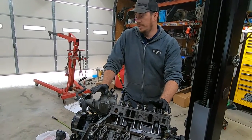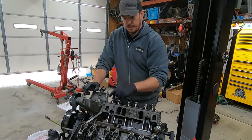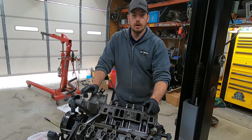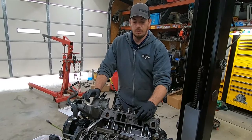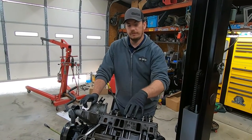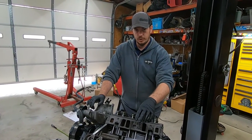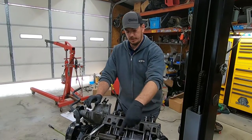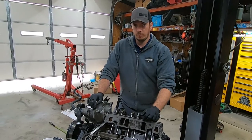The next step, I'm going to wipe the china wall down on both ends, brake clean the intake, and we're gonna put some silicone down, and we're gonna go ahead and set the lower intake. O'Reilly's is bringing us a new fuel injector. We are converting from multiport into sequential, so there's a conversion kit that takes the old spider and converts it to one with actual injectors out of the cylinders. So we're gonna need that because we're gonna make more power.